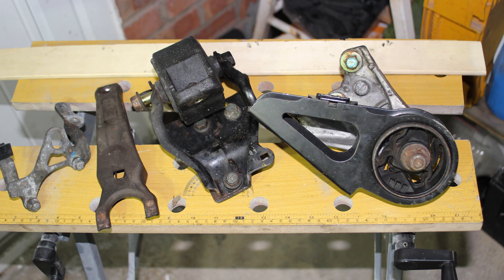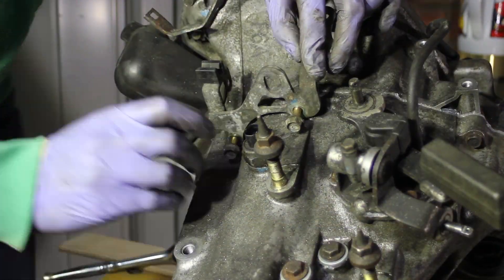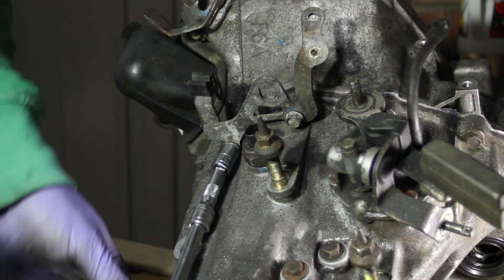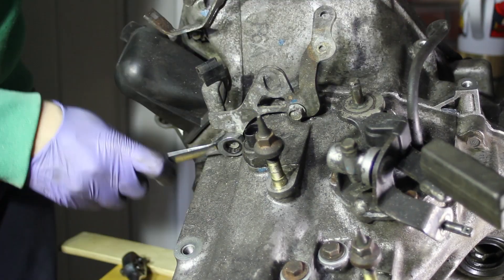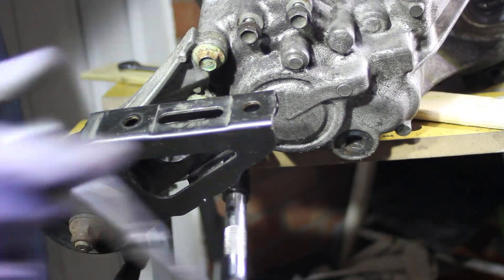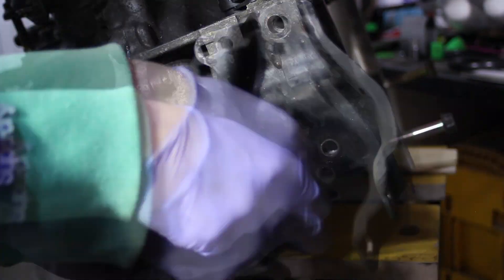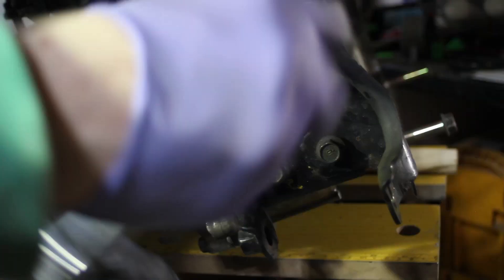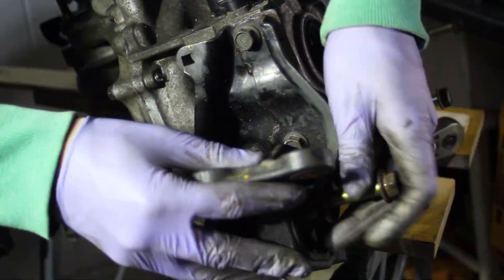These are the four parts to install on your new working gearbox. Reversing what we did before, we're putting the mounts back on. Had to use a ring spanner because we couldn't get the socket in from every direction. We put on the back bracket - the one that fits near the wheel arch - and the one at the back of the engine, then put the mount bushing back. If it looks worse for wear, it's a good point to stick a new one in.